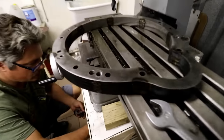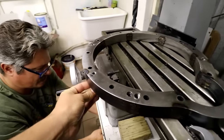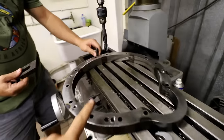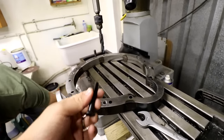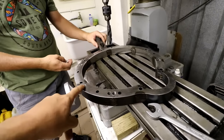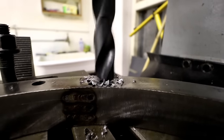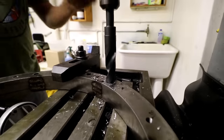We've done all the threading on all of them. Now on the ones that are not threaded, we're going to stick those high tensile bolts through — these are countersunk, so we need to countersink them onto the plate. The reason is we want this plate to bolt onto the engine with these bolts, and then we'll use the threaded ones to mount the bell housing of the gearbox onto this adapter plate. We also recessed the remaining holes so the countersunk bolts would fit perfectly.